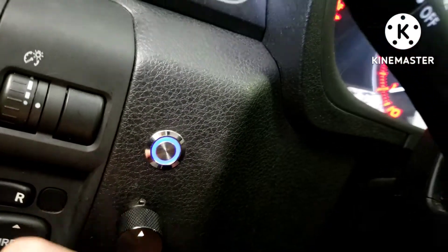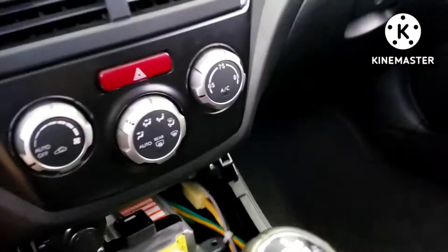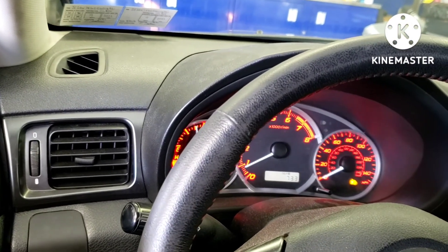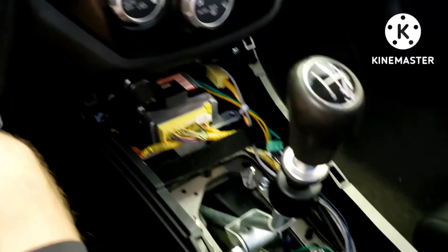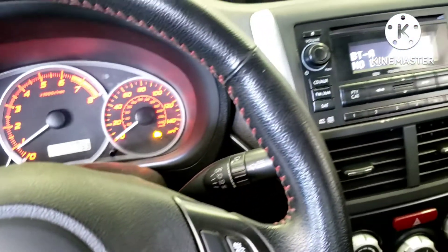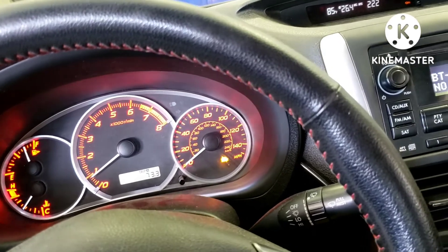Set it to auto and that's it — all done. When the chipped cover goes back on it'll be a seamless install — no wires anywhere, everything looks good. It took about four and a half to nearly five hours total, mostly because locating the TPS wire required a lot of testing and taking things apart and back together. The second time around would be much quicker, but it's definitely a bear of a job. If this video was helpful please give a thumbs up, and subscribe for more videos like this.